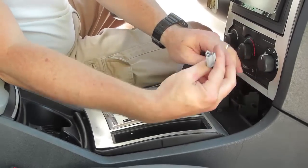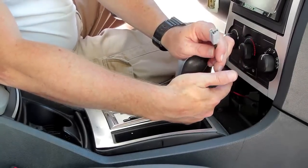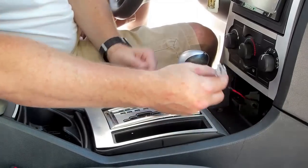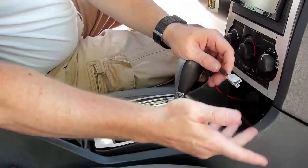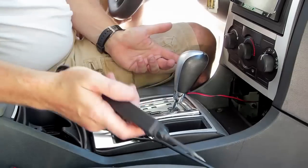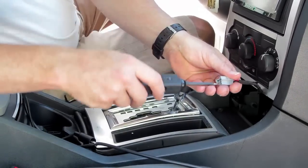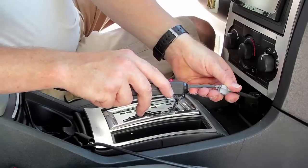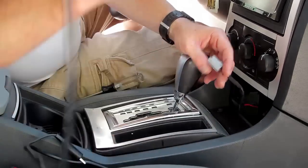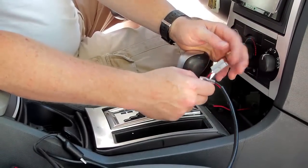If you want to make this reversible, you do not have to cut off this plug. In my case I am NOT going to cut off my plug — I'm going to connect onto these existing wires, which is reversible so down the road I can put it all back to stock. To figure out which wires do what, you're going to need either a multimeter or a test light. I'm going to use my test light and go into the plug — there's my power and over here is my ground. Mine goes red to red and black to black, but in your vehicle that'll probably be totally different.